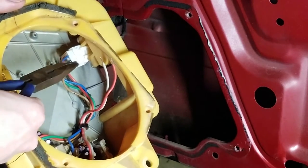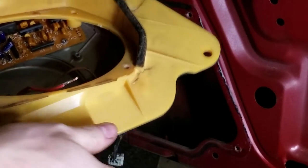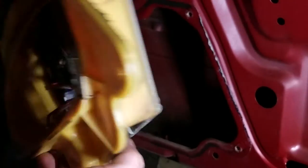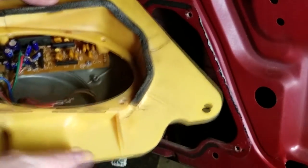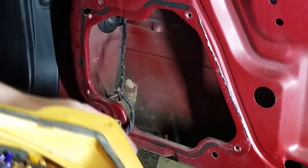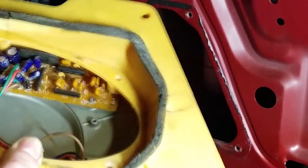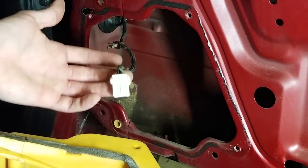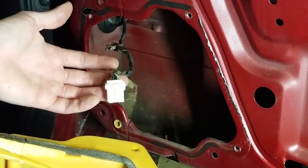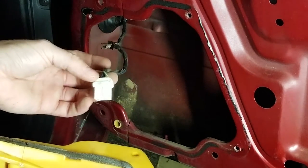Now I just need to wiggle this plug out. That is not a trivial process — just be patient with it and it should come out. Now that we have this piece out of the car, I can go ahead and flip it around and pull out all of these Phillips head screws. But first, before doing that, I'm actually going to test and see if any of these wires actually work, because it wouldn't make sense to delete the amp if these wires don't work. If they don't work, I will just have to run my own speaker wire from scratch, which I don't want to do, but that's what happens when you have an old car.